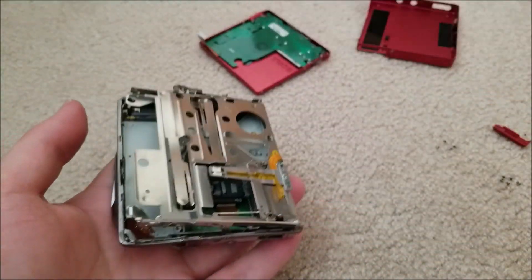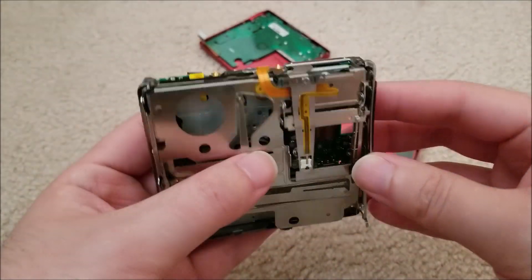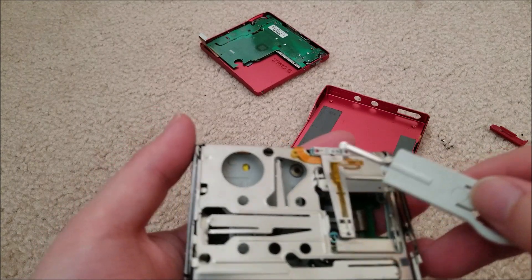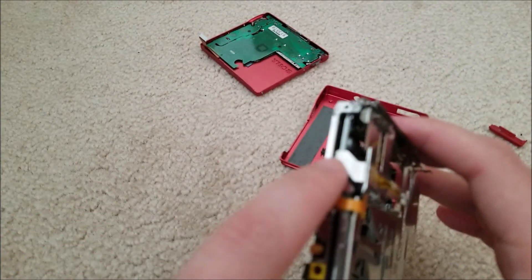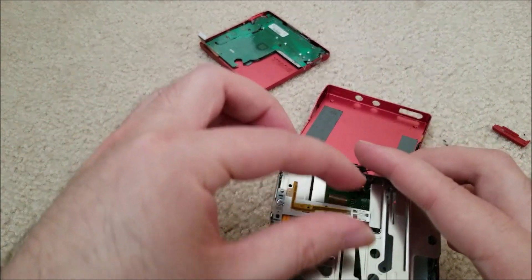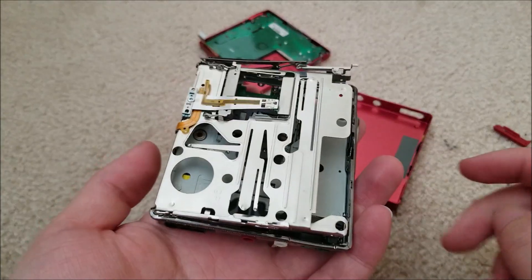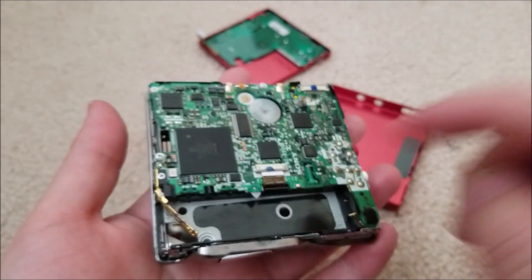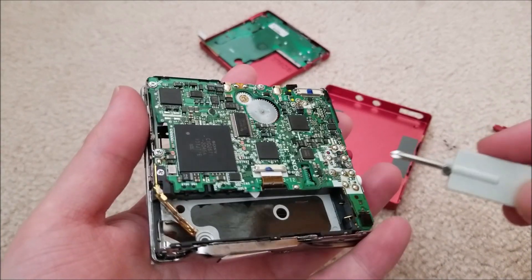Okay, I've actually shown how to open this up and the laser before in a previous video, but this time we're actually going to get into the mechanism itself. Luckily the head has some glue to keep it aligned, and there's a screw. It looks like there's a bracket that goes from the laser underneath to the actual overwrite head, keeping them aligned so they both move at the same time. We're going to have to unscrew that from the old one and screw it onto the new one. We need to get down to the board, take out all the screws, undo the ribbon cables, and swing this out enough to access the mechanism underneath.